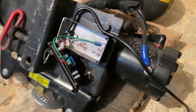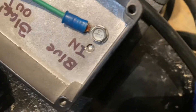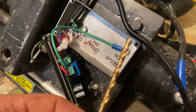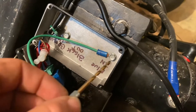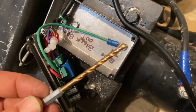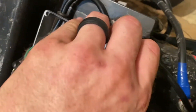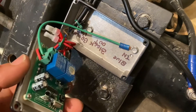As you can see, I got the self-tappers in. Had one fail me — I should have drilled the same size or one size under the threads. I did it one smaller to see if I could get a really tight grab, but it was unnecessary because they got a good grab with the size slightly below the threads. Box is on there, got it grounded, everything's ready to go.